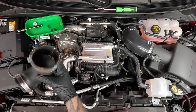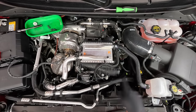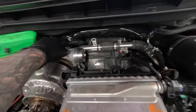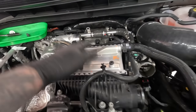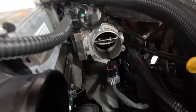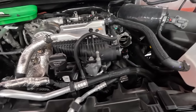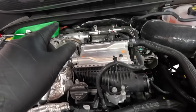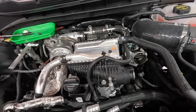We can see the oil that's in there — not much, not as much as I was expecting, so that's a good thing. There's our oil inside the intake manifold. That's all passing through — that's a closed PCV system. This hose right here is what gives off the oil vapor: it goes into the turbo, through the turbo, through the charge air cooler, and into the intake manifold, which then burns in the cylinder and goes out the exhaust. What I don't like about it is it also goes into the particulate filter, the DPF. We have a catch can planned for the future — rather than it going into your engine, you catch it and drain it out.